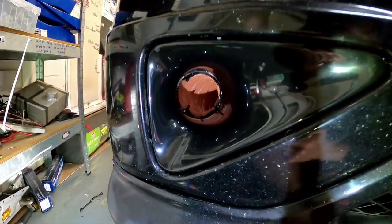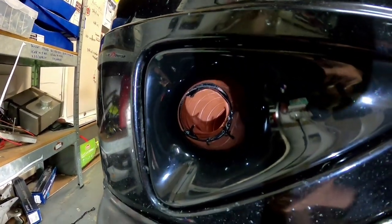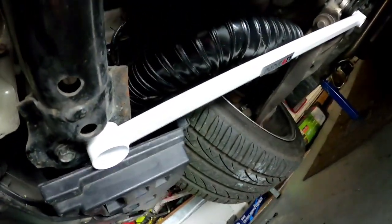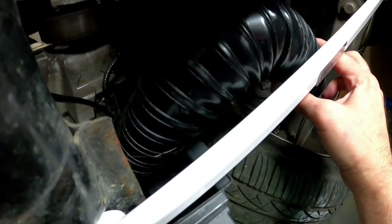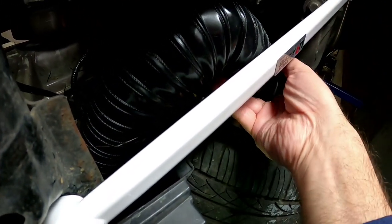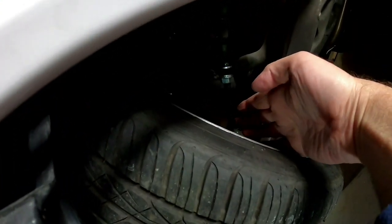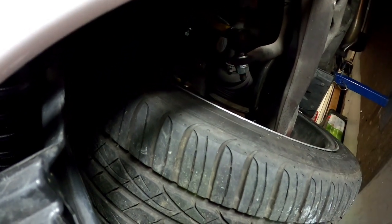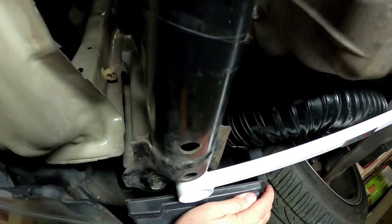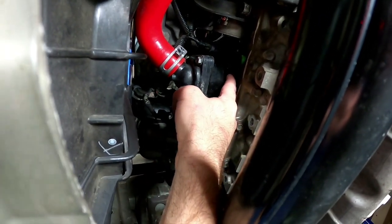In here you can see I've got the silicon brake piping — it fits in quite well. It's a little bit too small in diameter but I managed to wedge it in there and it's held with some tape and cable ties. Lucky I've put these Ultra Racing braces on because this is what's actually going to hold the brake ducting down away from any other parts. If this wasn't here I wouldn't have anything to mount it onto. I'm going to make some alloy brackets to go around there and clamp onto the line. Since I'm deleting the fog lights anyway I might as well run the air to do something. While I was here I also discovered the thermostat housing is leaking, so I've ordered a new one — a Spoon one — and also the back hose that goes off the back of that.